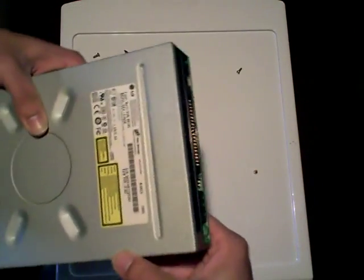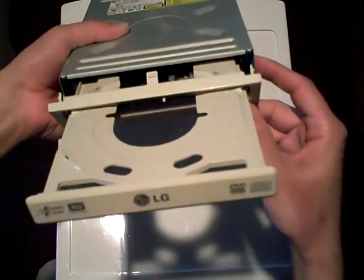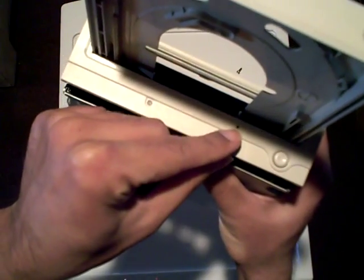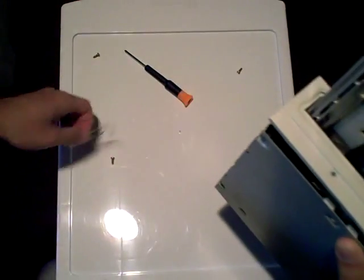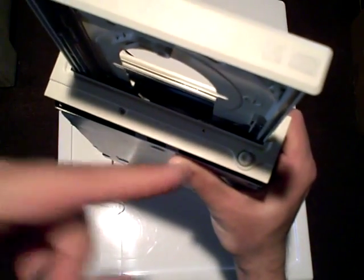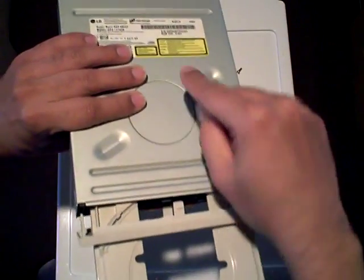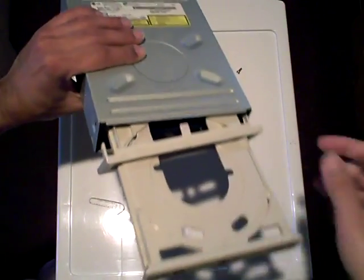Of course, the easiest way to do it is to provide a power feed to your optical drive, open up the disc tray, and then disconnect it from the power feed — that's the easiest way. Or, if not, most optical drives have a lock disengage hole, which you could use something such as a paper clip, or a pin, or a thin nail to push through, which will not only unlock the mechanism, but cause a gear to push the tray out a tiny bit, which will allow you to disengage it.